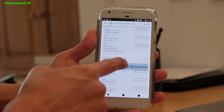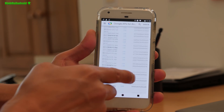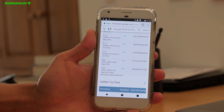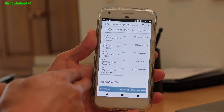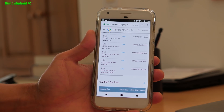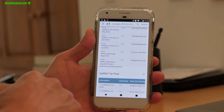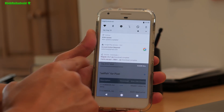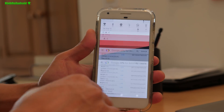We're dealing with a rooted phone with TWRP recovery here. I'm going to go to Pixel XL, scroll all the way down, and download the latest one. You can also downgrade to a previous Oreo if you don't like Pie, but I'm not sure if the data is compatible going from Pie back to Oreo. Upgrading works fine, but downgrade I'm not sure about. I'm going to go ahead and download Android 9.0 — I've already downloaded it: Marlin OTA PPR1.180610.01.